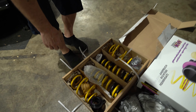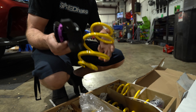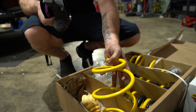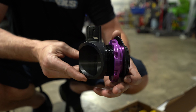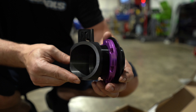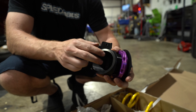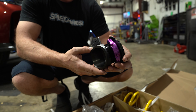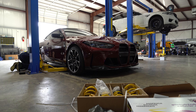These are height adjustable springs. I'm going to pick up the fronts just for example. Your spring is pretty normal, but this piece here will replace the lower hat on the strut itself. After we get the strut out of the car, we'll press that off and press this one on to take its place. We'll walk you guys through that, so stay tuned as we knock this car out.